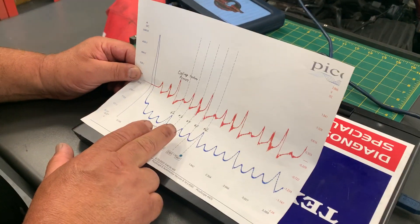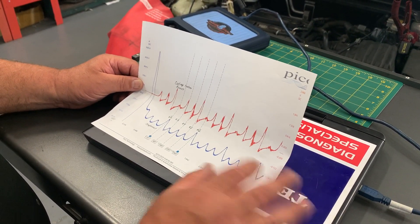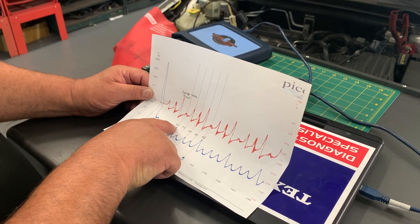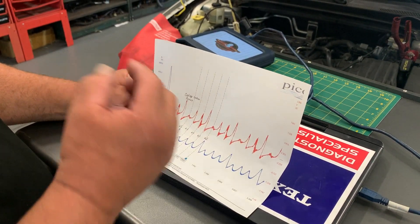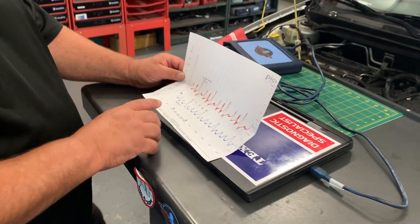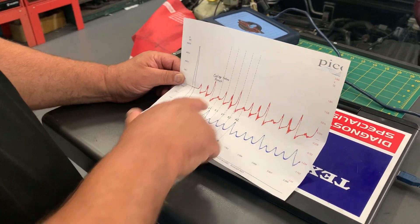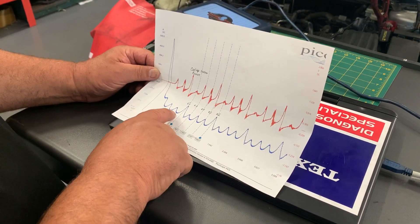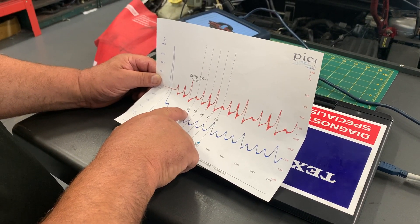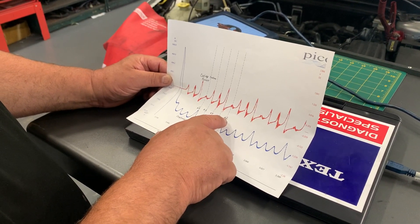The firing order shown is one, three, four, two, and back to one again. When it peaks up, that means there's a load on the starter — that means that's compression. You heard one of the cylinders going when cranking over — that is the compression load on the starter. Every time it does that, the amps go up and it records it. You heard one cylinder running with compression; the other three you didn't hear anything from.